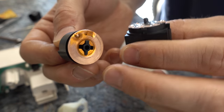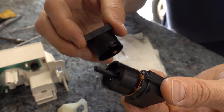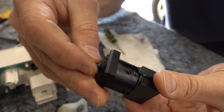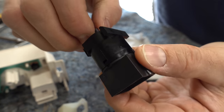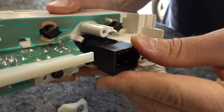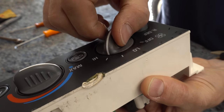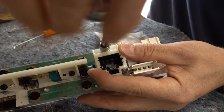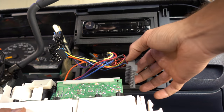Hopefully we won't have this problem again. Now when I put this thing back together, you can see there's an indent there, and that's where this nipple is going to go. So this is going to go something like that. The way we know how to put this thing back together is because that locating tab goes right there. So let's go ahead and slide these two back together, making sure that our switch is in the correct location. Perfect — everything is back together the way it should be. We can test this switch out. So now we can take this switch and put it back into the control panel, and that is back in place. We can put our knob back on. Everything seems to be functioning perfectly normally. We can also put this final piece back on. Before I put this entire thing back together, I'm first going to plug this in to check that everything works properly.